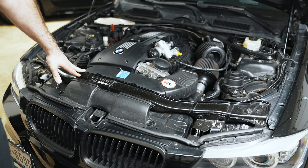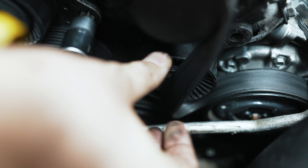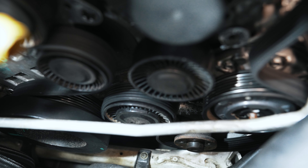Remove the fan shroud and disconnect the electrical connector — there's one T27 Torx at the top. I have an aftermarket oil pressure sensor I disconnected the harness from, then went after a screw below holding the trans cooler to the shroud. I removed the inlet to create working room, though it's not strictly required. Before releasing the belt, crack the 13mm power steering bolts loose. The belt tensioner takes a T60, then go after the bolts to take the pulley off — I upgraded mine to metal.